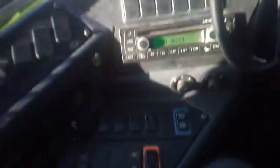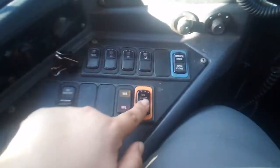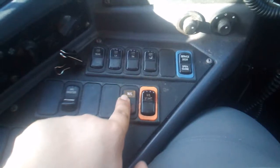Next we're going to check to make sure our warning lights — the ambers, our caution lights — turn on as they're supposed to. Warning lights: push that up, it is blinking, and the light indicator is blinking next to the switch. Check to make sure you see it in the crossing mirrors that they're blinking. Go up and verify that they are working on your light monitor.